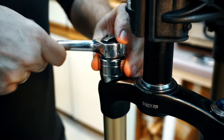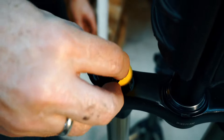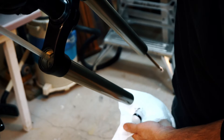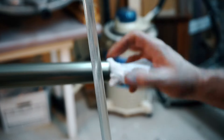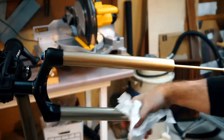Step 4: Clean the upper legs. Remove the air spring top cap with a 27mm chamferless socket. The yellow foam volume spacer can be trimmed or removed if you want to change your fork's progression. Push out the air piston, which you will be replacing if you have a new one, otherwise you will just be cleaning it. Clean out the inside of the air spring with alcohol, making sure to use a non-metallic rod so you don't scratch the inside. Thoroughly clean the outside of the fork.